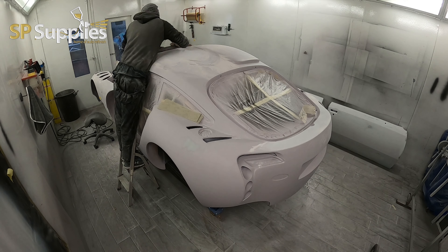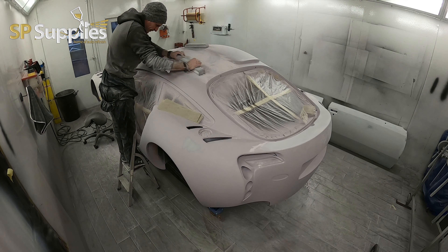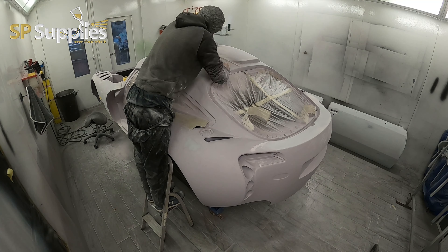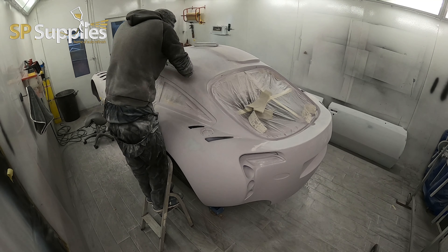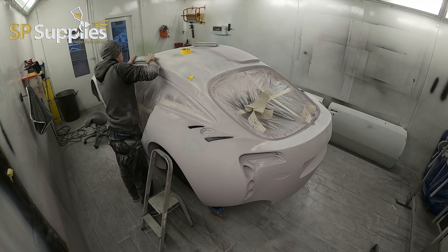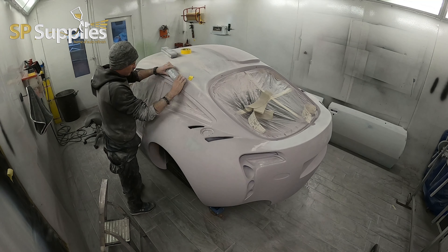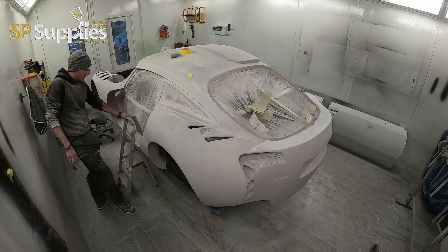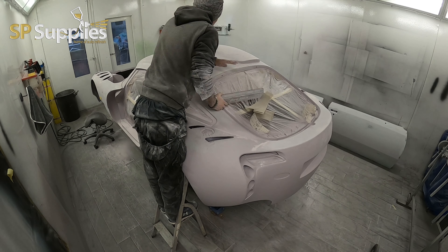You've got a really good spray filler there, and if you wanted to you could work up the grades and paint on top of this. For a job like this, we're using it as an epoxy to seal all the body and also as a very high build polyester spray filler. I'm going around stage by stage, separating it into sections — wing, front, other wing, quarter panel, half the roof, the scoop, and so on. This was literally a 12-hour day of solid blocking start to finish. It's not a small task to block out a big car and get it perfectly flat.